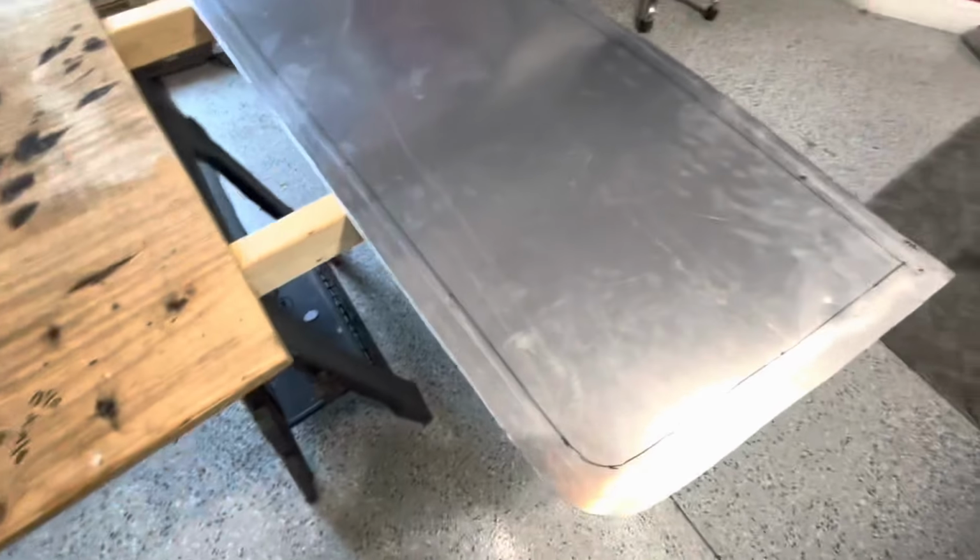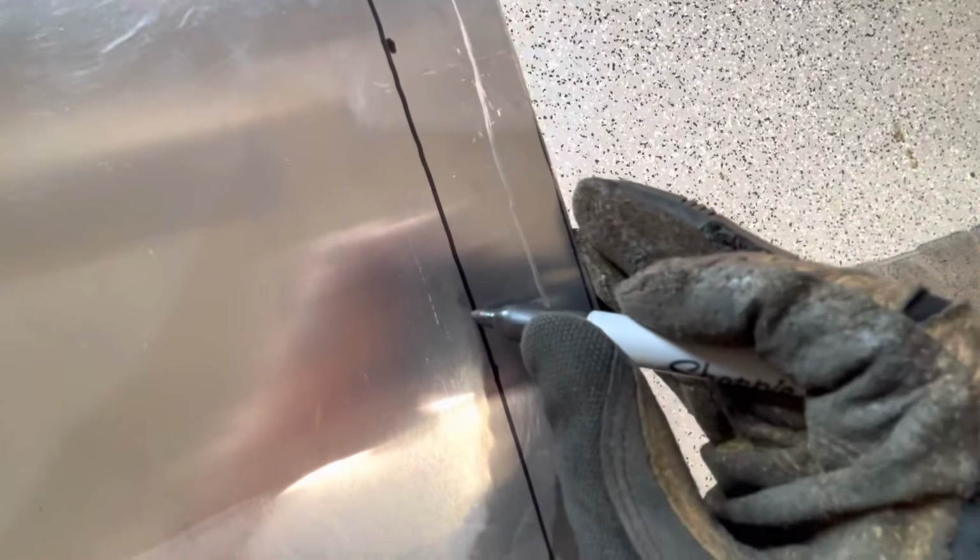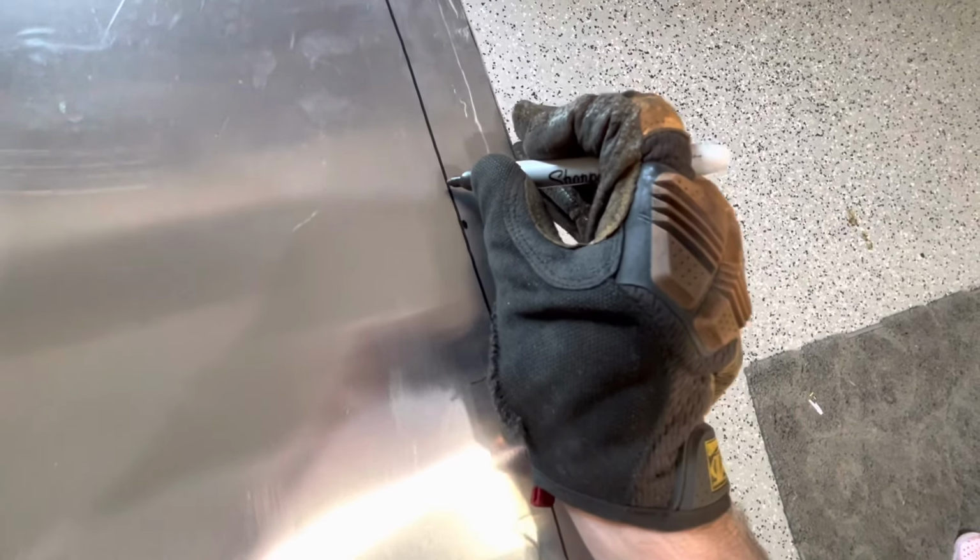But then take your Sharpie, and if you've ever done sheetrock when you were younger, which I did do, or in your life, you know, hold your Sharpie like this, get your depth selected, and you're running your finger along the edge. Make sure you have gloves on. But then you can just pull it like that, okay? And you can just draw it. And you can go forward if you want. It's a little harder, but normally it's easier to drag it like that, okay?